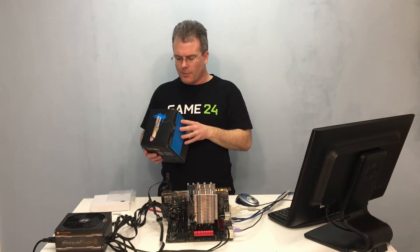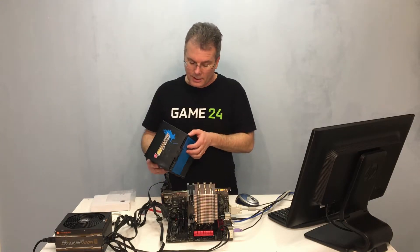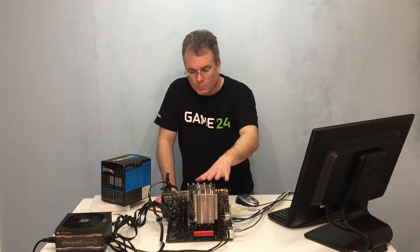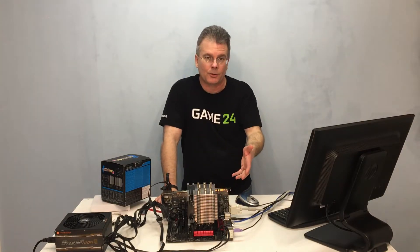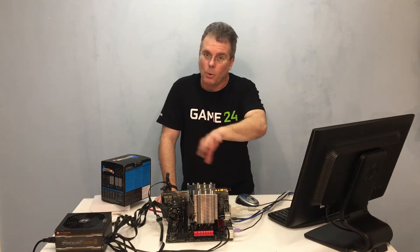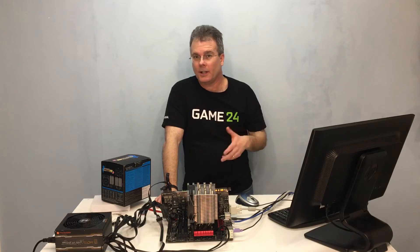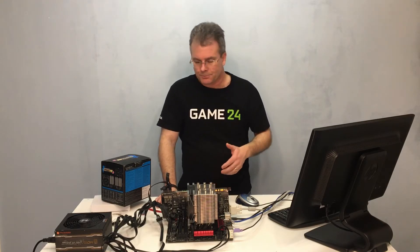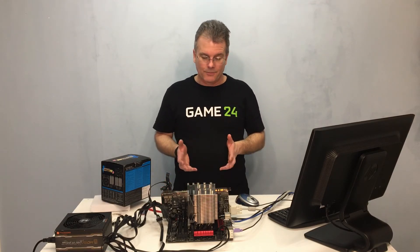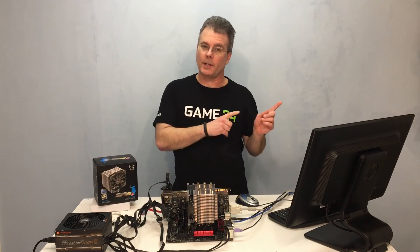The fan name — I'm probably going to slaughter it — is the Kaze Flex 120 PWM fan, so it is a four-pin fan. Very quiet, no problems moving enough air to keep CPU temperatures down. I also noticed that inside the case the rear exhaust fan was close enough to help pull a little more air through, which tells me a second fan might help keep temperatures even cooler if you do a lot of overclocking or put a large load on the CPU. The cooler comes in a little under $50 — I think it's a good value and you get a lot of bang for the buck. Again, this is the Mugen 5 from Scythe. This is Chris with Overclockers Club — thanks for watching, and don't forget to subscribe.